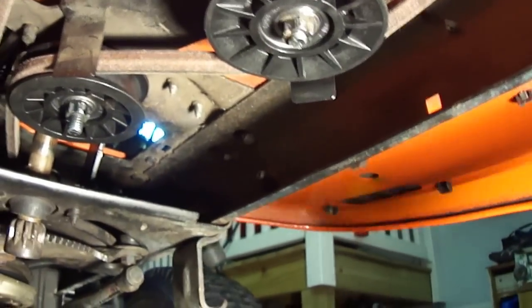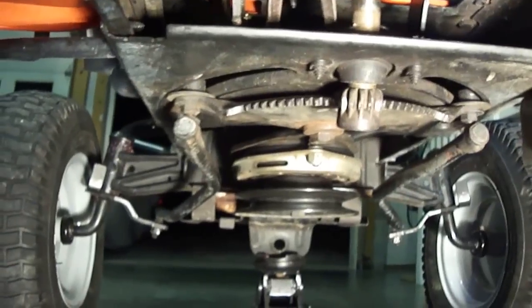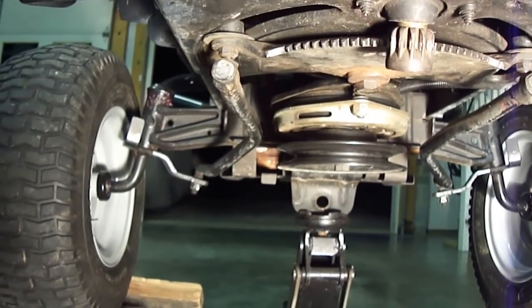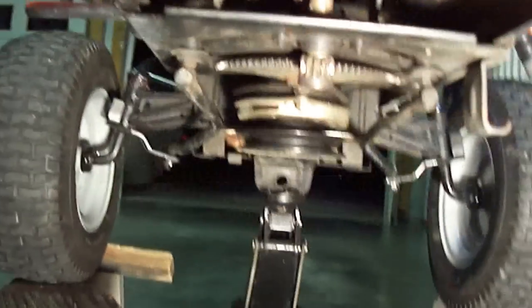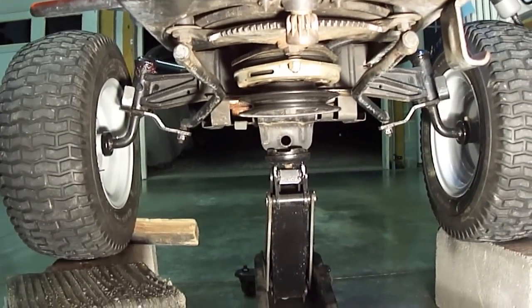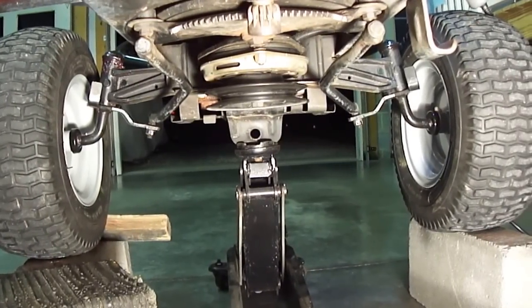how it feeds through. These were all 14mm nuts as well. And so basically just keep in mind that your belt feeds through the left side to the left side of your steering shaft, okay? And I will say that the factory service manual recommends that you start your belt from the rear and move it to the front.